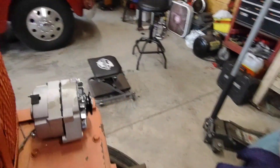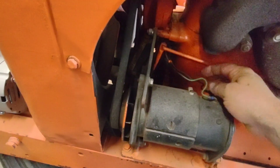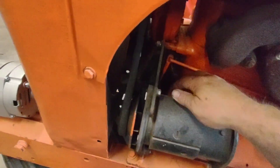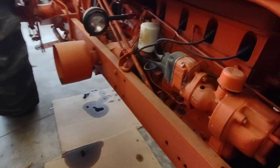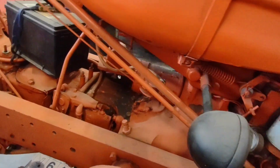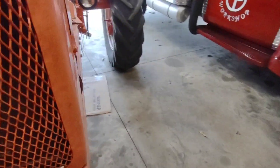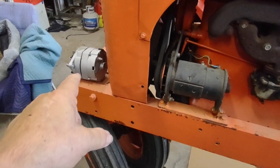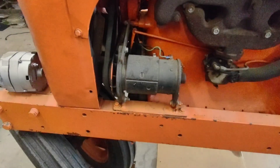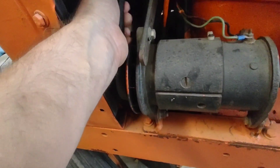So I'm going to work on getting the old generator off first. I don't need both of these wires ran, just the one. I may or may not eliminate that other wire — he's got it ran and tucked in pretty good; it comes around here, goes through a grommet, and up through where it's supposed to go. We'll see — I may leave it or cut it out. Anyway, the main thing is getting this old generator off and getting the bracketry redone so we can mount the alternator. The wiring can be done later. This is going to be the harder part — some cutting and welding on that bracket — and that belt's about shot anyway.